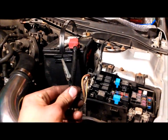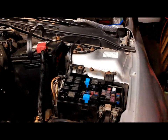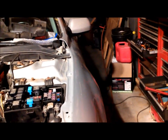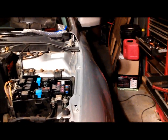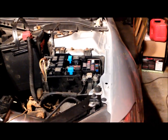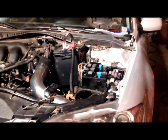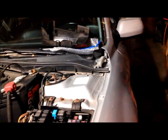So I took a little alligator clip wire and went right to the S-terminal on the starter, turned the key on, touched it to battery power, and it turned over. I pulled the fuel pump fuse because I wanted it to crank and lubricate everything — who knows how long it's been since it went to the junkyard. It's been dry since I don't know when, so I just cranked it over for about 30 seconds.